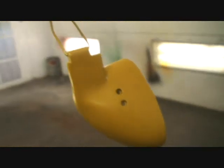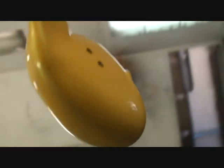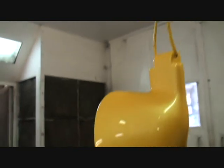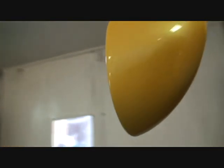Okay, if you look at our mirrors, this is plastic. These are the plastic mirrors that messed up on us. You can see that they're painted and done. I got 4 full wet coats on it. You can see the shine that has been put on it. You can see how it has laid down very nicely, okay? And that is because we wet sanded it with 400 and a block. We did not use our fingers. You can see the sheen is very, very nice. And got our stands painted.